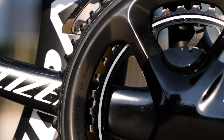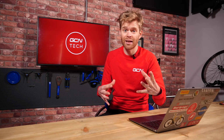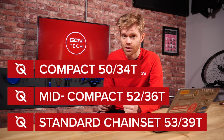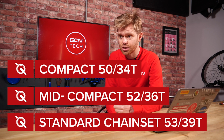A standard chainset, which was kind of a lot more common back in the day and is still what the pros tend to use, is a 39/53. But for most amateur cyclists, this is a bit too tough on the hills, and they prefer that compact. And that's why bike brands ship most bikes with a 34/50. The halfway house between this is a mid-compact, which is a 36/52. Now, you could switch out to that or go the whole hog and get the standard chainset.